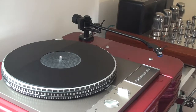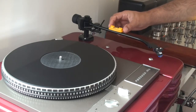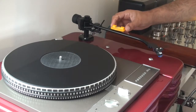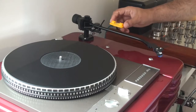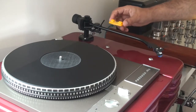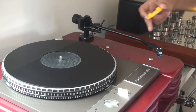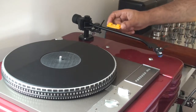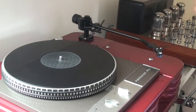The first thing I like to do is check the balance on the arm itself to be flat. When you place a spirit level on it, the bubble inside that spirit level should be somewhere in the centre. This is actually showing me that it's not, which is useful because I can show you some of the adjustments you might need to make on your tonearm. This is a Jelco 750, which is a 12 inch tonearm, but most tonearms are relatively similar in that they have a mounting point, the arm itself, and then the head shell, which contains the attachment for the cartridge. This is showing me that it's not flat — the bubble is way off centre, so it's obviously got quite a significant angle on the arm.